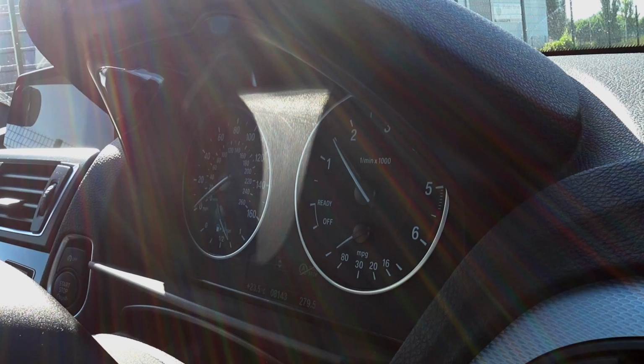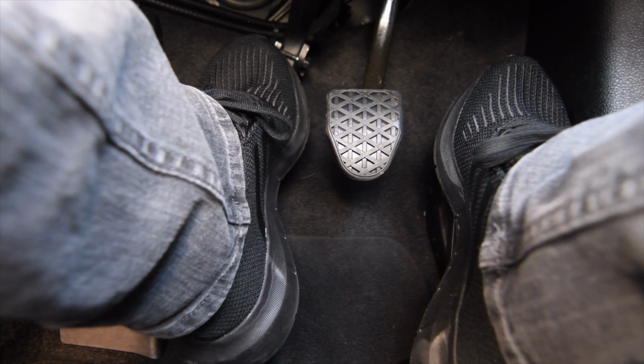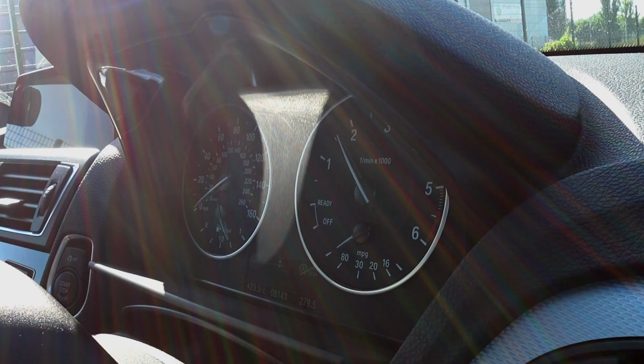So try and do that yourself, but if you've got a rev counter, we're after a fair bit, up near 1500, but eventually listen to it and try and use your ears to actually sort this situation out. So, we've now got enough power. When I now find the bite, all that's going to happen is, yes, the engine has got a little bit more load on it, and there it is. You can hear and actually see the rev counter just take that drop.